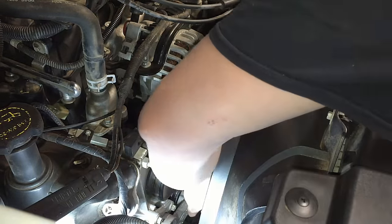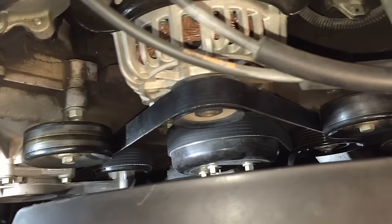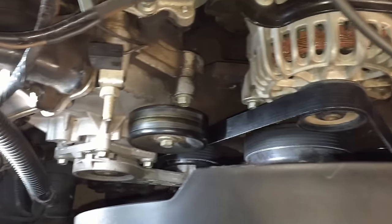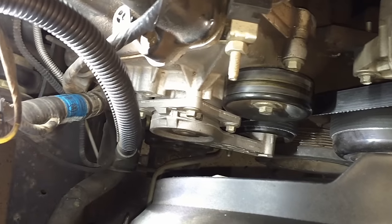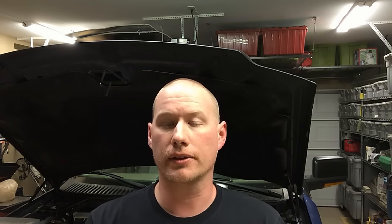Let's bring you in here real quick for a post check to show you how it should look. There'll be a diagram in the description for the belt routing. All these 5.4 and 4.6 engines are almost exactly the same in belt routing. The last thing you've got to do is put the air cleaner housing back on — make sure it's all tight and secure and all those hoses get put back in. As a post check, start it for a second or two after it fully starts, then shut the engine off. Go out with a good flashlight and check the pulley routing all the way around to make sure the belt is tracking properly. You don't want to ruin the new belt. If you follow these tips and do that pre-start check, you really shouldn't have an issue — it'll fall into the grooves and track on the smooth pulleys just fine.